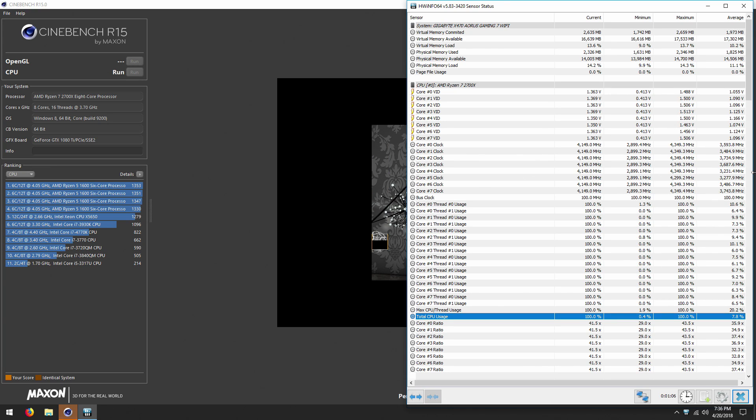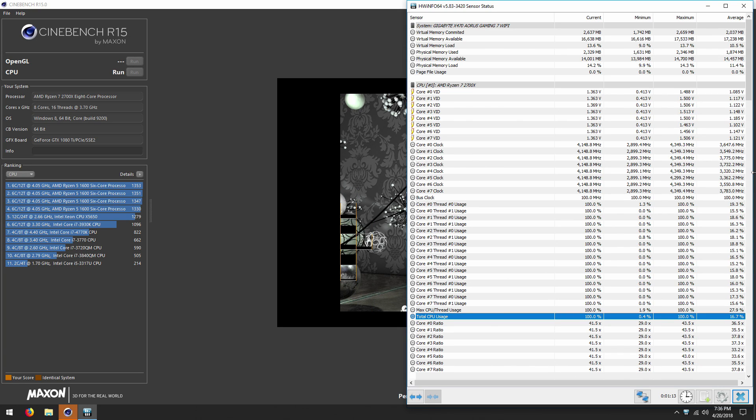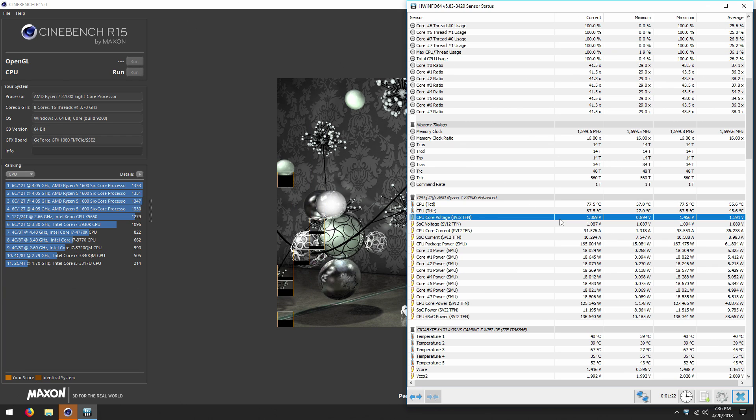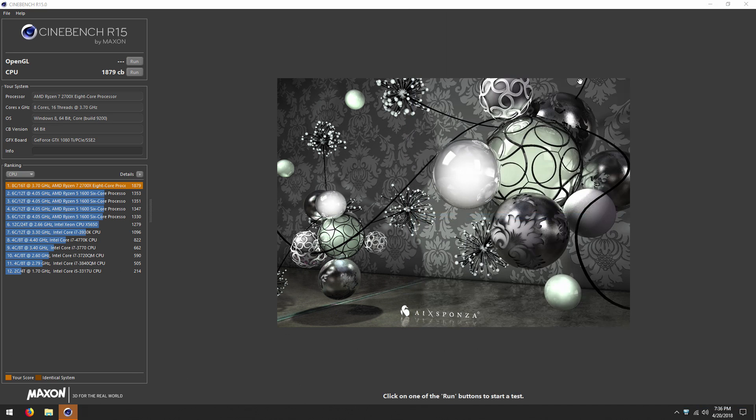It can be a little bit more dynamic. Right now it just doesn't want to go beyond 4150 MHz. I've seen it go to 4175. But anyway, 4150 — 100 MHz up. Voltage is around 1.367V. As I mentioned, if you use the Wraith Prism cooler it doesn't work that well — it just increased around 25 MHz. Voltage will be the same. It's actually really sensitive to the cooler you have. Cooling matters, and since this is an overclock, power supply matters too. The Cinebench score is way much higher — 1879.